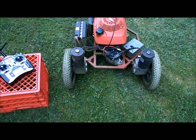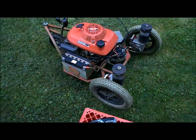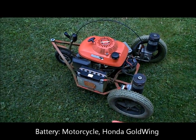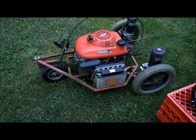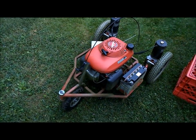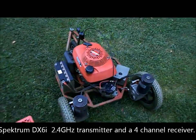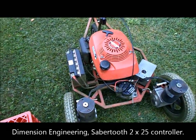The one-wire alternator does not require any switching — it only puts out electricity whenever it's running, and it only uses power whenever it's running. They're basically used in stock cars and racing cars. Because of the low requirements at idle, it keeps this motorcycle battery at 14 and a half volts.